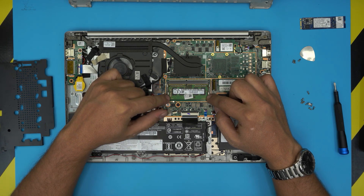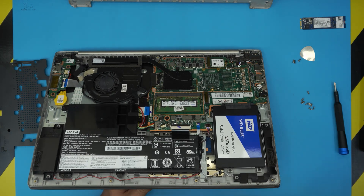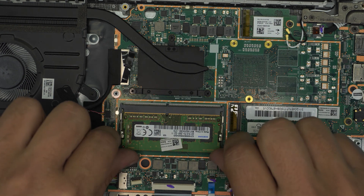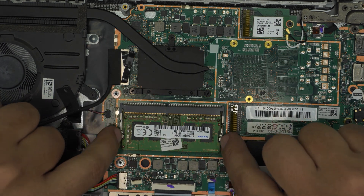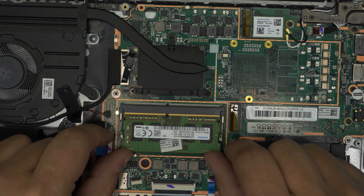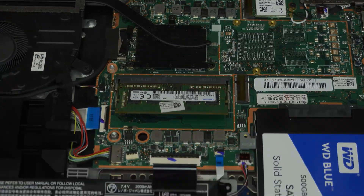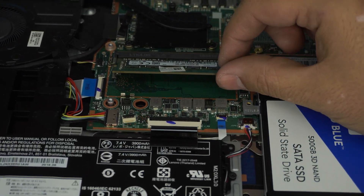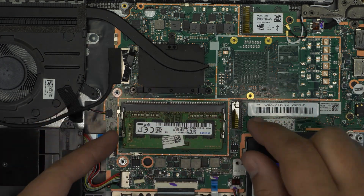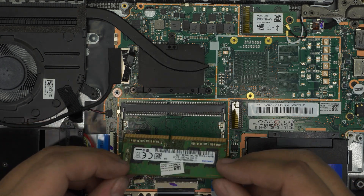The RAM should be right down here — I'll get a close-up on this one. There are two triggers on the side of the RAM. To remove the RAM, you don't just pull it up — you pull these two triggers apart with your fingertips. The RAM should come out at a 45-degree angle upward. You don't want to yank it straight toward the ceiling, otherwise you'll break the contact. Just grab it and pull it back the way it came out — it'll pop right out.